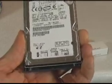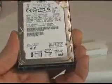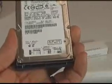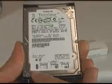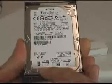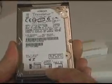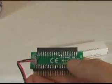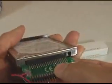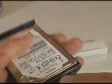It is important how you connect the adapter. You want to make sure you line up pin 1 with the red stripe on the IDE cable. As you can see on the legend here on the drive, pin 1 is next to the gap, next to the device cable select jumpers. On this adapter they have also marked where pin 1 is, and you want to make sure pin 1 lines up with pin 1 on the drive. Then slide that together.